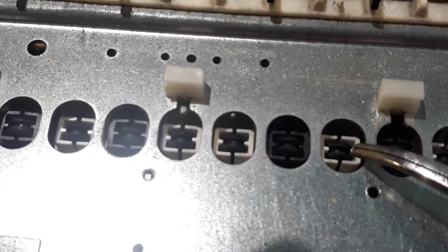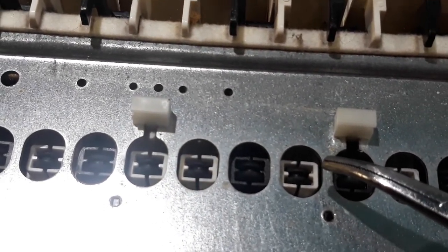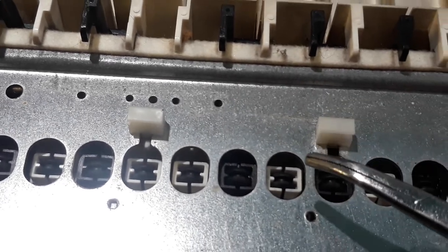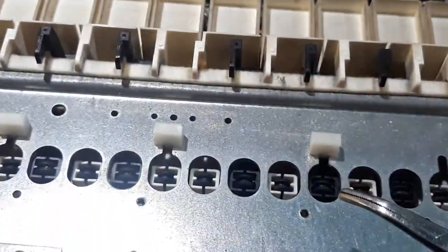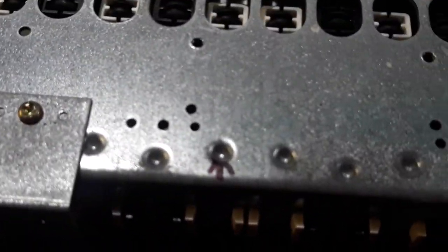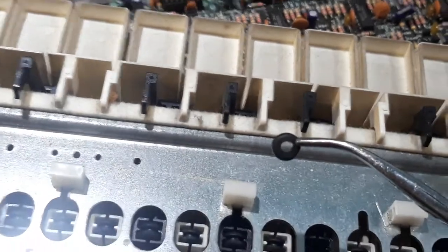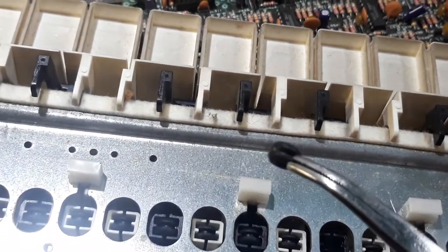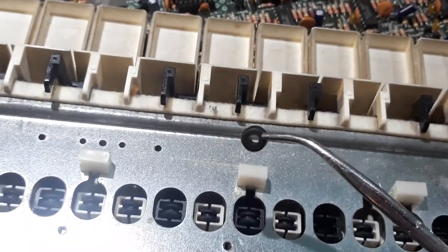This is the part that pokes through this little pill-shaped hole and presses that down and activates your key. How to make these extend just a hair bit further so that all of them press that suction pad down well enough to make a good, strong contact with the contacts underneath without throwing off the action of the whole keyboard. I happened to have thousands of these little rubber grommets, and I'm going to try to find the exact part and include a link in the description.